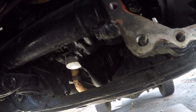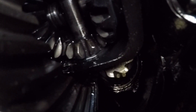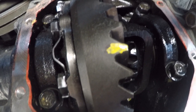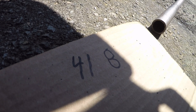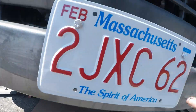There ain't no number in the ring whatsoever. So here's the next best thing — I marked the ring and I marked the pinion, and I'm gonna count and see what we got for teeth. I can't screw this one up, so I'm not trying to do this while holding the GoPro. Counted all the teeth — came up with 41 on the ring and 8 on the pinion. Now I'm gonna go call East Coast Gear and see what they have to say.